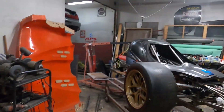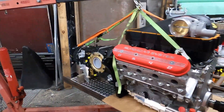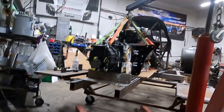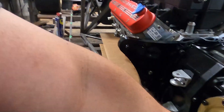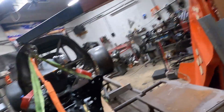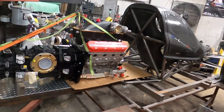I have no idea if that's in the right spot yet - I literally just set it up there, but it looks pretty good, relatively level. I just have to measure left, right, front, back. With the new wheelbase I need to make sure this is on center with 110 inches behind the front wheels, give or take. A longer wheelbase means more downforce, more load on the floor, so that's super fun.